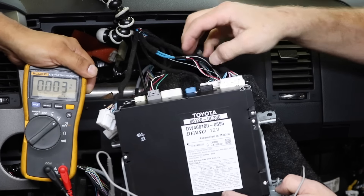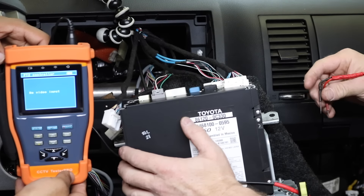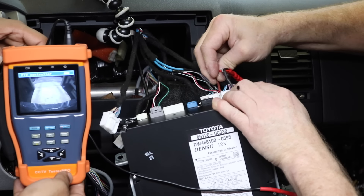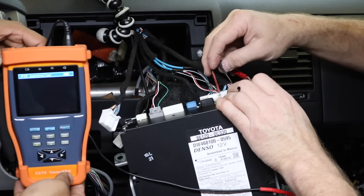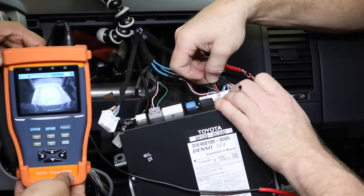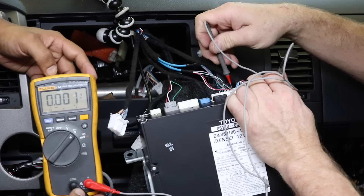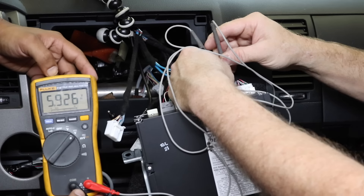Now we need to find the camera signal. For that we're going to use our CCD tester. You can use any monitor — a headrest monitor or anything like that to do this. You basically want to take one of your connectors and put it to ground, then start probing. And there we go. Remember, there are only four wires, so it's not like we're getting that lucky — there's not that many to choose from. Now since we know that's the signal positive, we'll test the wire next to it — and there you go, we have the signal negative. So we know what three of our wires are: signal positive and negative. Now we just need ground. My guess is it's going to be this gray wire next to the black. We'll go ahead and put our meters back into that — and it is. So we have our 6-volt power and ground identified.